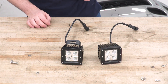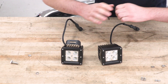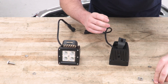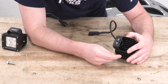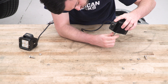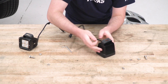We're just going to do the same exact thing for the second light. Grab the bracket, make sure the notch cut out is toward the front of the LED light, drop a nut down the fin, get that bolt started through the nut and tightened down, then jump over to the other side of the light and do the same thing.